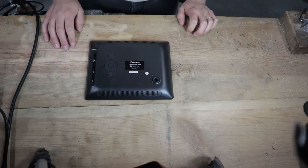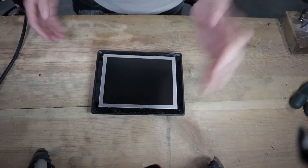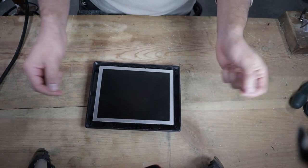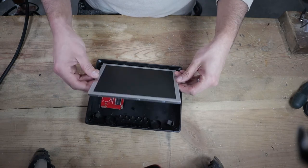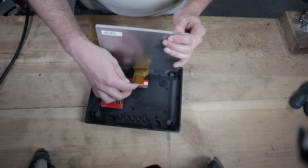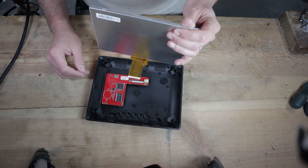So let's get this thing taken apart. We have that front bezel taken off and here we're just going to remove the screen now. Be very careful when you're lifting this off — you're just going to flip it up and all you want to do is release this ribbon cable, just pry up that little clamp there and it's going to come right out.